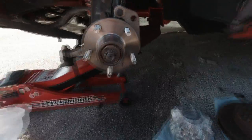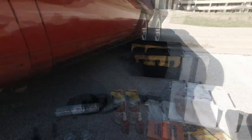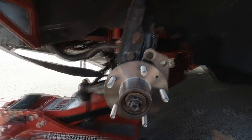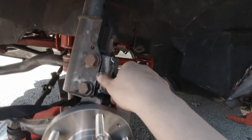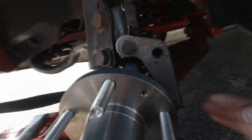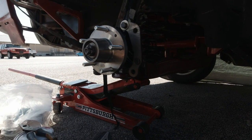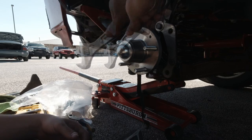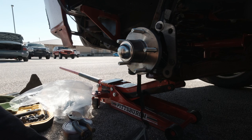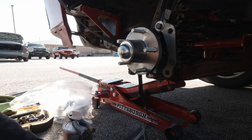Looking at this, I'm pretty sure I can't put the stock rim back on. Worst case scenario I'm running just like this until I get brakes, since this thing obviously isn't going anywhere soon. One thing to mention — I did have to put a washer here because I didn't drill in far enough, so I ended up washering it just that little sixteenth of an inch out so it would grip. But the moment I've been waiting for — dust shield first, then caliper. Dust shield is satisfactory. Just give it a little tap tap. That looks beautiful guys, that is a work of art.